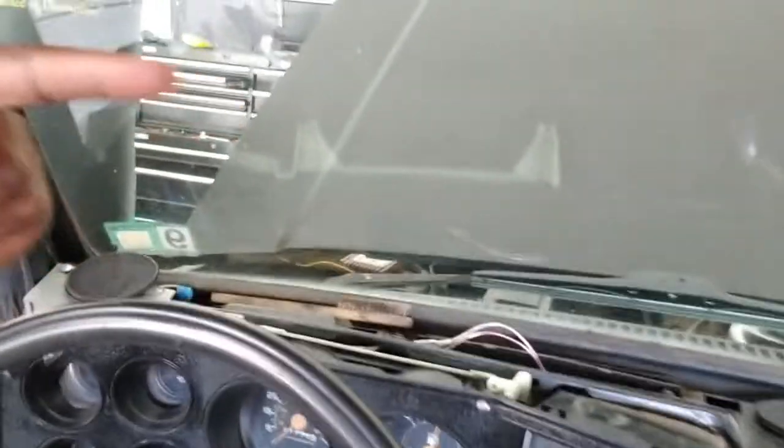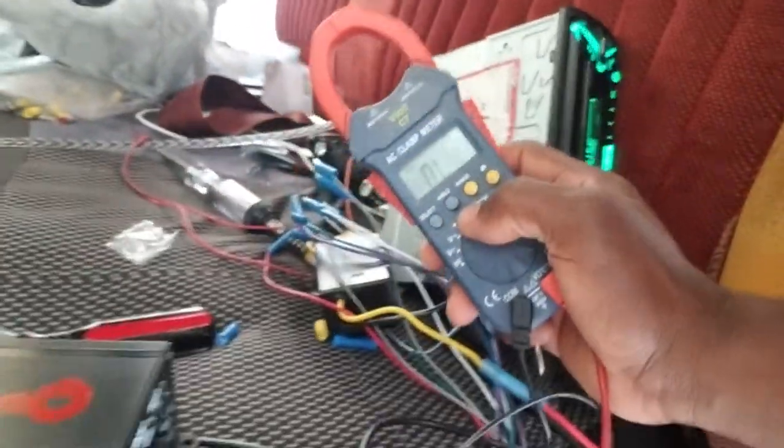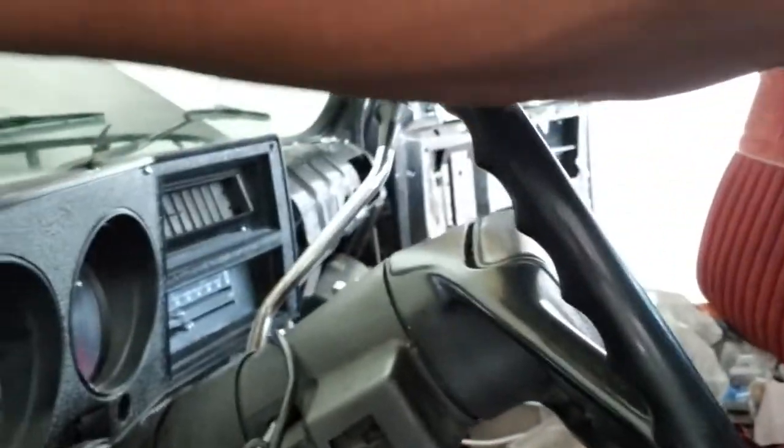I was having the same issue with the front speakers. Keep in mind that these speakers are rated at 4 ohms per speaker. I got four 4-ohm speakers and I had these two wired together and those two wired together over there. The problem you run into when you run those two speakers together is it goes from a 4-ohm impedance down to a 2-ohm impedance — more like 2.5, but closer to 2 ohms. It measured exactly that. But after I disconnected the center speakers from this channel, the amplifier is pushing these two 4-ohm speakers with no issue at all. To address the issue, just get your ohm meter, set it to the ohm selector, put the probes on the speaker leads, and that'll tell you the impedance if you're not sure.